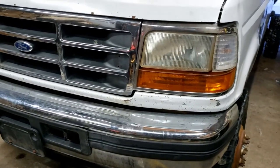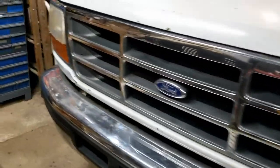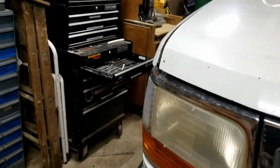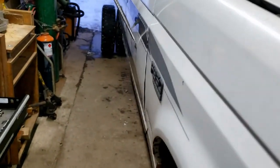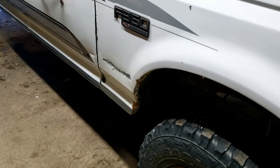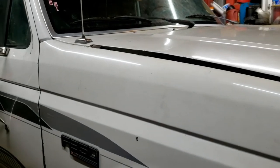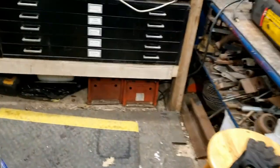So in the midst of troubleshooting that, I went ahead and repaired a vacuum line for the blend door actuator. And I thought maybe that was leaking and contributing some to the issue, and it probably was, but certainly not enough to make that big a difference. And even after I repaired it, still didn't have brakes or good vacuum. So got that taken care of.